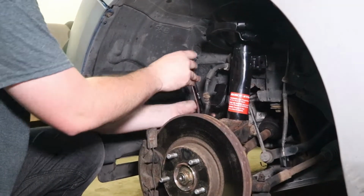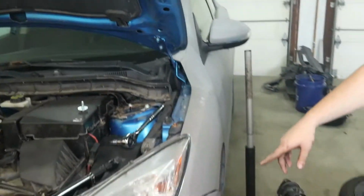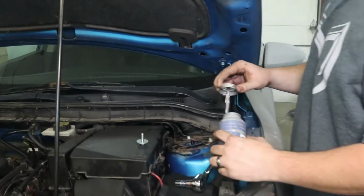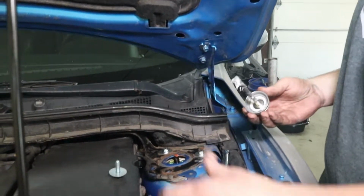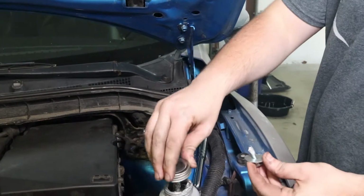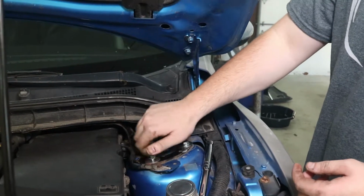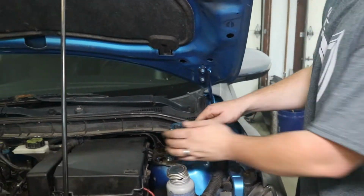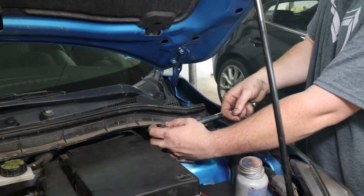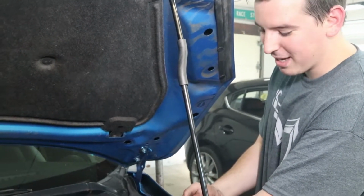Snug it for now. So we ended up pulling these 3 bolts and the knuckle bolt and putting anti-seize on them because we forgot. So put anti-seize on the final one here and reinstall it. It's a bit much. You don't need much. If you don't use anti-seize, you get what we had when we were trying to remove it. Yeah, a mixture of no anti-seize and over torquing them the last time.